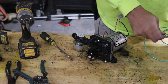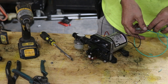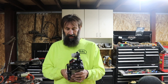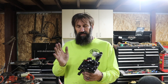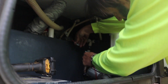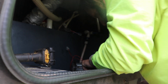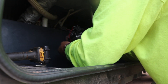We're still working! Okay, we know the motor's now working. We're going to bring it over to the RV, plug in the RV, and before we put the screws in, make sure it's still working. Then we'll put the screws in and the hose lines and see if we get water again. Unplug it, plug back in — power is still on so it should come right on. That's working, we heard it running. Let's get it all plugged back in, screwed back in, and then we'll see if we get water from the faucet.